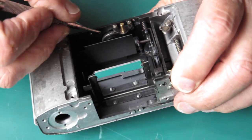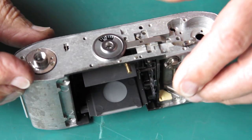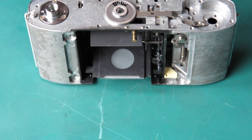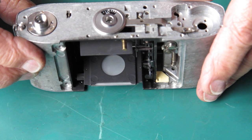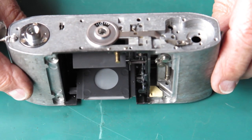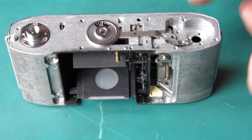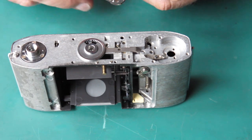If we were to move it forward here, it rotates smoothly enough. There's no ratchet action there of course because there's no ratchet for that particular component — it's the friction of our wavy washer that holds it in position. With that piece out of the way, that's a very handy thing to have done. Now I'm going to lubricate the film advance shaft with some graphite grease.